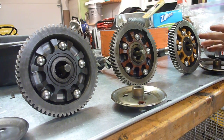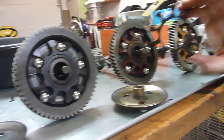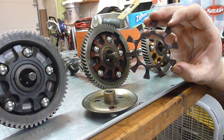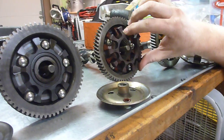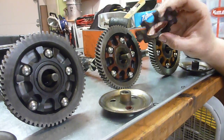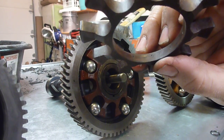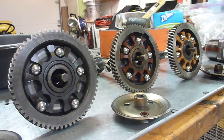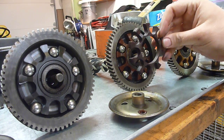There are three different types of flyball spacers. Over time — this is the flyball spacer outside of an engine — this is the P218 plastic flyball spacer, probably the most common out there. It fits onto the cam gear, and what happens is over time it starts to rotate on the cam gear once the engine gets hot. The link in my signature describes the flyball spacer fix, and that's what this problem originates from — the plastic spinning on the camshaft.